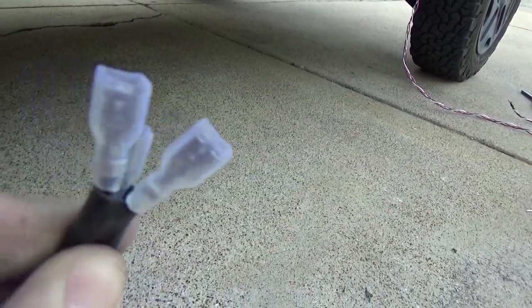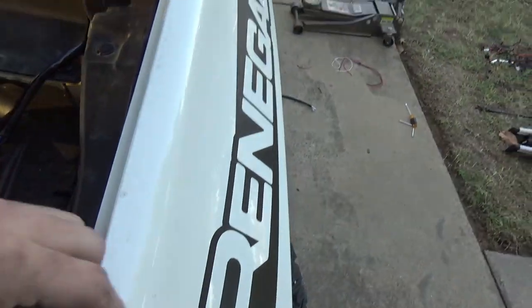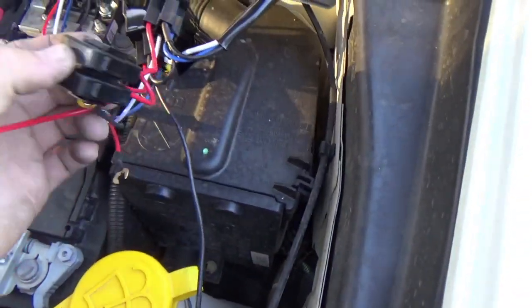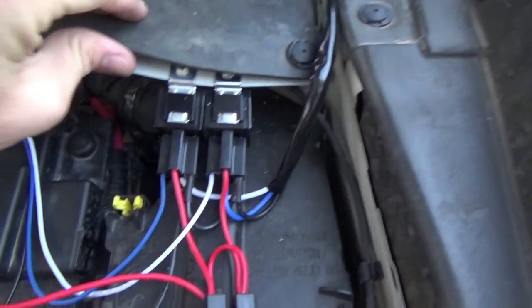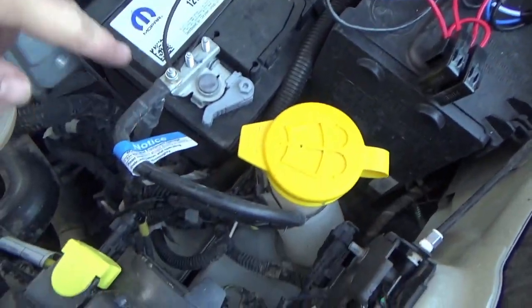I got these connectors so I get to cheat — I'm going to tie it to the end of that connector, cut that one off, and it's going to meet somewhere around where those doors meet, and I'm going to plug them in. I'm going to plug in the battery part — there are like four of these for some reason but that's detail. The two fuses are going to be right alongside the relays and we're going to start her up and just hope she works. I got the relays done, popped this off and self-tapped them in right there. Relays, fuse, hooked up the positives under here and hooked the negatives up right here.